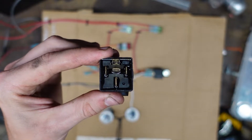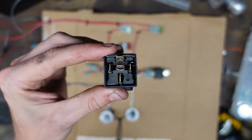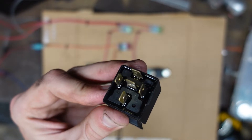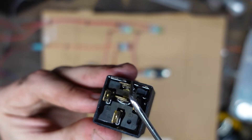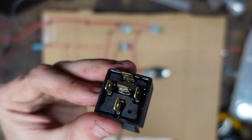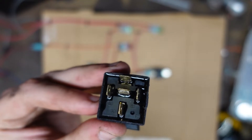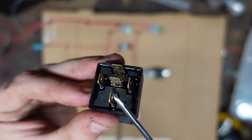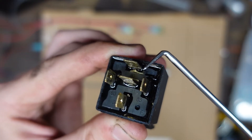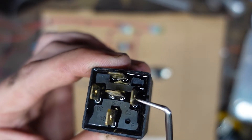When wiring up your typical Bosch style relay it's important to make sure you put everything in the right place. There are three vertical pins and two horizontal pins. The center of the three vertical pins, or the bottom one in the row of three pins, is your input power. The center most pin is normally closed and the top center pin is normally open. When this relay is hooked up and not triggered, the center pin will have power and the top pin will not have power. The two side pins are your trigger wires — polarity does not matter, one is power, one is ground. When the relay is triggered, your center pin will not have power and your top pin will have power. So the power from the battery will go to the lower center terminal, the output to the fan will go on the top center terminal, the trigger power will go on the left, and the trigger ground to the ECM will go on the right.